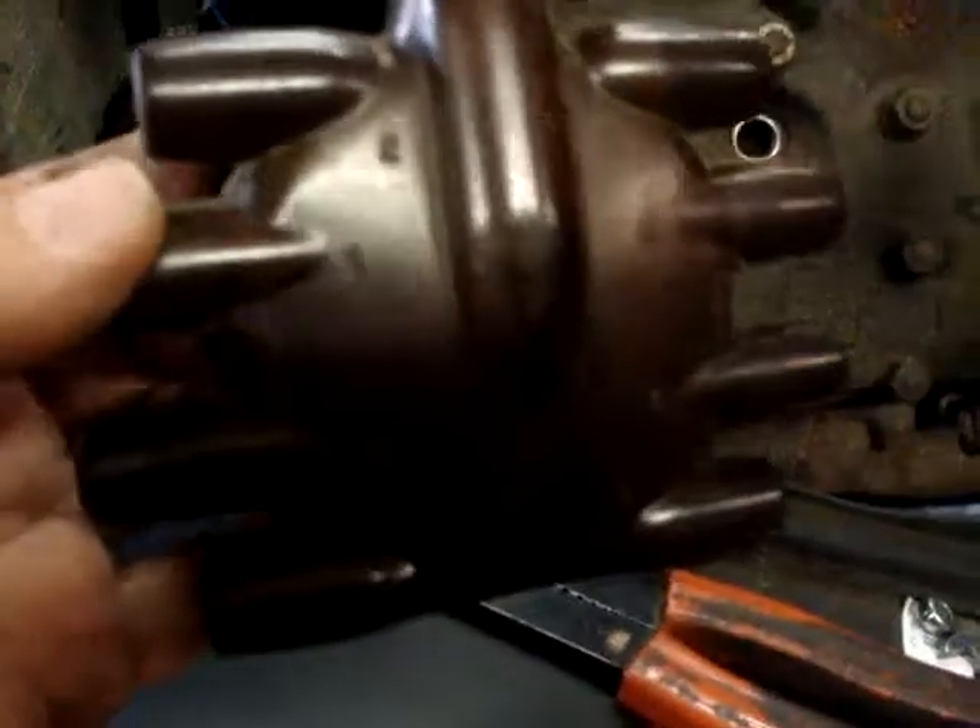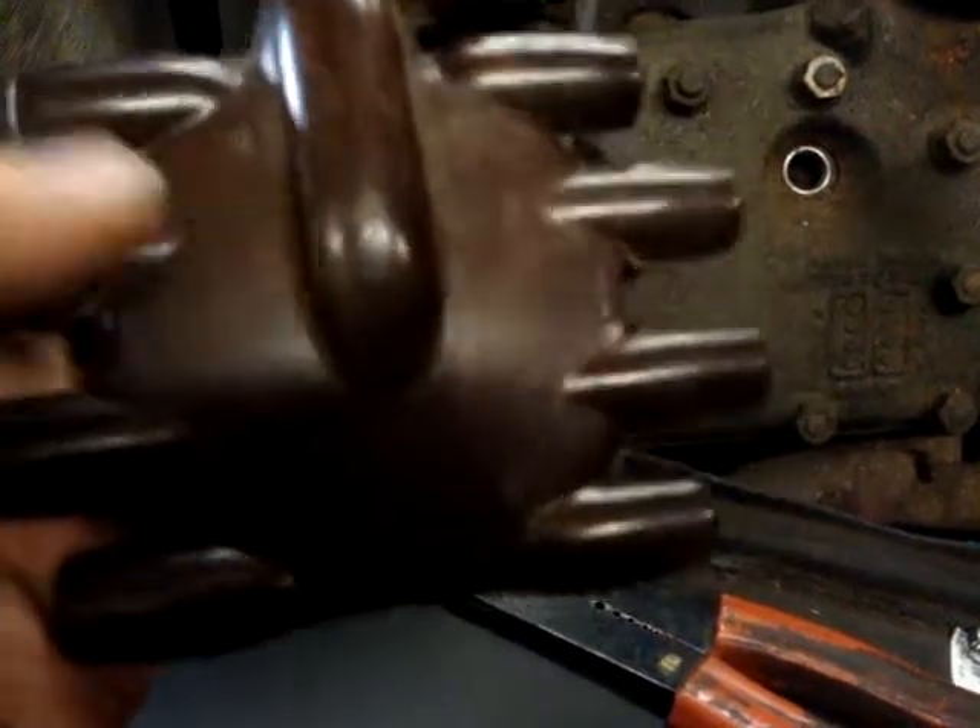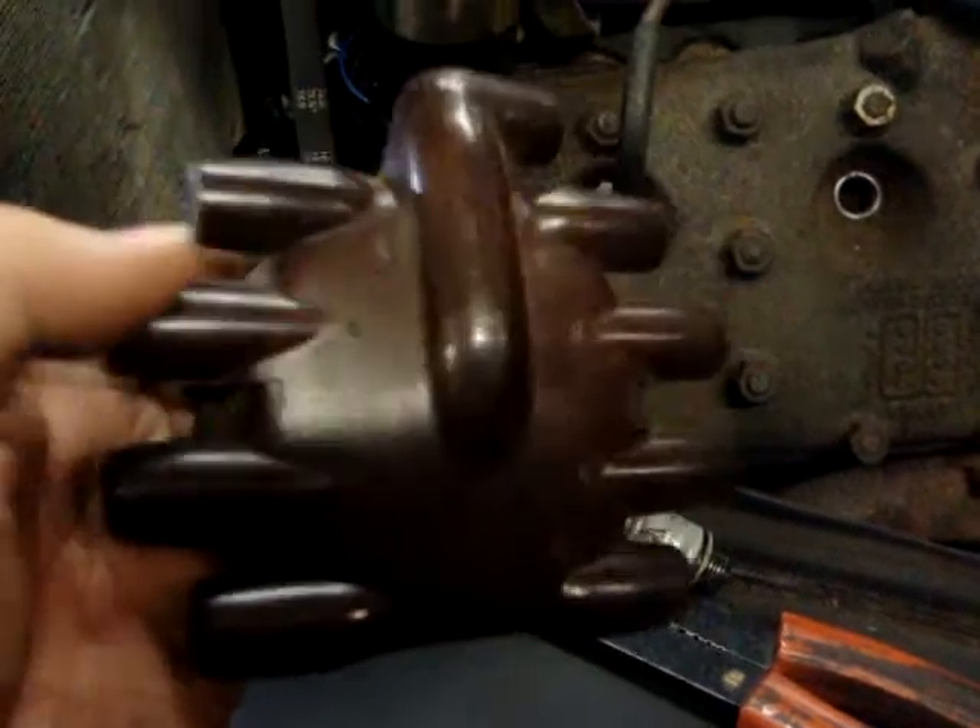There's the distributor down the front there. Let's take the cap off. I've never used one of these before, but I'm looking at that rotor arm — I can see it clearly, but you might not be able to see it on the camera — the rotor arm is kind of looking at the ten o'clock position, the brass end on it. Now these caps are a bit of a nightmare. I'm not going to take that one apart, but I do have a crab cap. This is a crab cap, and it has the numbers marked. The one at the ten o'clock position is number one.